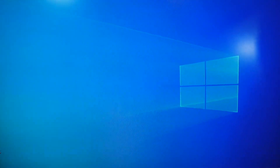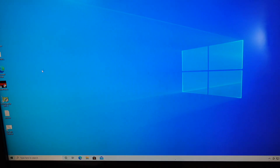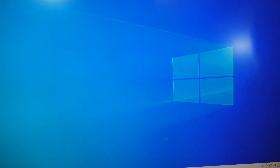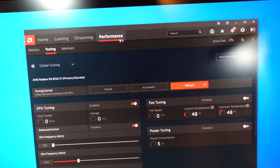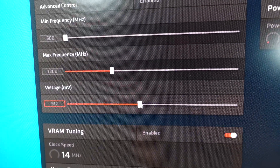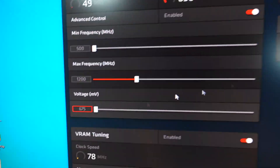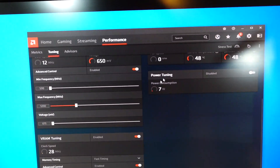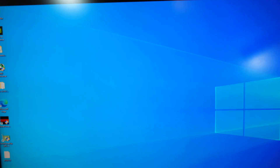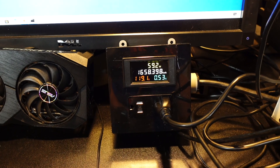Okay, we're back in Windows. Let's go ahead and open up AMD Radeon Software again and I'll show you what we can do now that we changed the soft power play table. We're back in our performance tab. Now you can see I'm at 912 still, but that slider's got some room to move. I'm going to bring that all the way down to 675, hit Apply Changes. Everything else remains the same. Minimize this and we'll start mining Ethereum and see how low that gets that wattage.